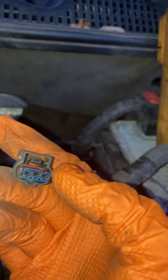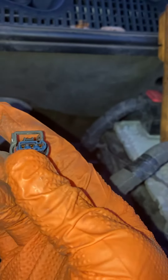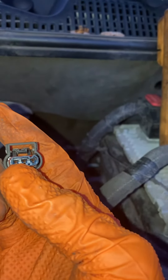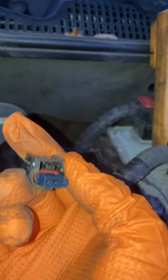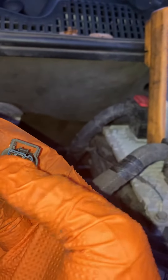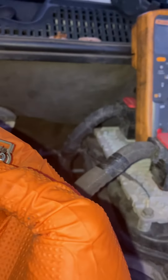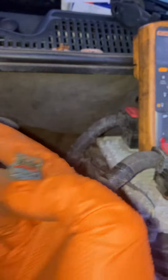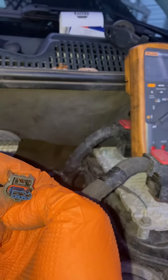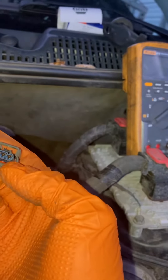For the middle ground, I put the test light on the positive battery terminal and then touched the middle ground pin — the test light was nice and bright, so that tells me the circuits are good. While checking the power supply voltage and the signal voltage, I was wiggling the harness around to make sure it was a constant voltage and it didn't drop — everything was good.